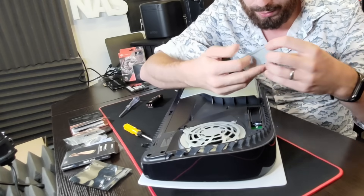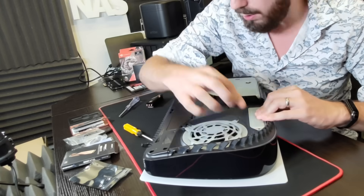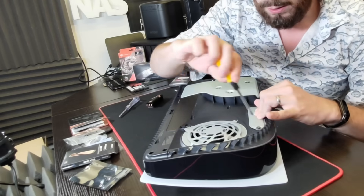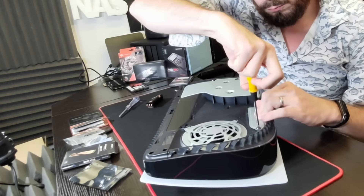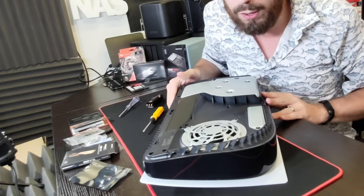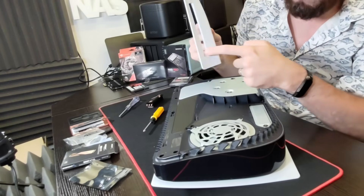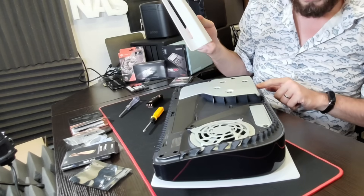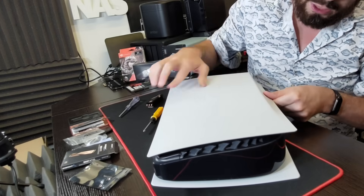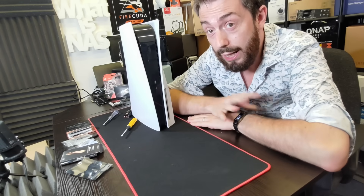Now take the panel back and secure it back into the slot. It will fit straight in. Take the screw — the one with the PlayStation logo on it — grab the screwdriver and screw it back in. It's that straightforward to install an SSD inside there. Then simply take the lid. If you've got the disc version, line up the slot with the disc bay. Otherwise, line up the curvature of the chassis, place it over the top, slightly underneath, and slot it back on. We've now installed the SSD inside our physical PlayStation.